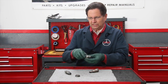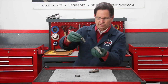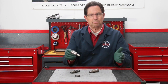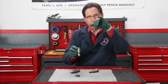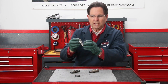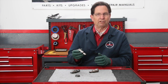Here's the fuel injector. For those who need a reference to where these pre-chambers are located, they go down in the cylinder head. The fuel injector screws right in here. When fuel is squirted into the engine it enters the pre-chamber before it enters the combustion chamber. There's actually a little ball located right here. When the fuel is squirted it hits the ball and disperses — the purpose of this is to increase atomization. The burn starts and then as the burn continues it moves out through these holes into the cylinder for maximum combustion. This is all happening very quickly — I'm explaining in very slow motion.